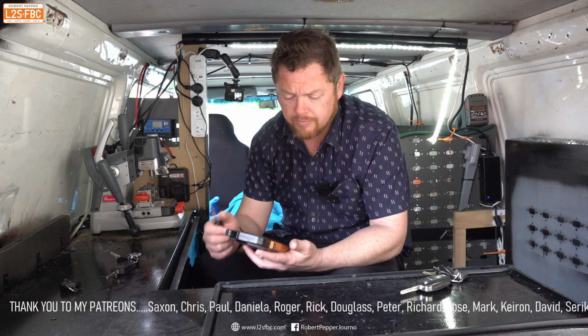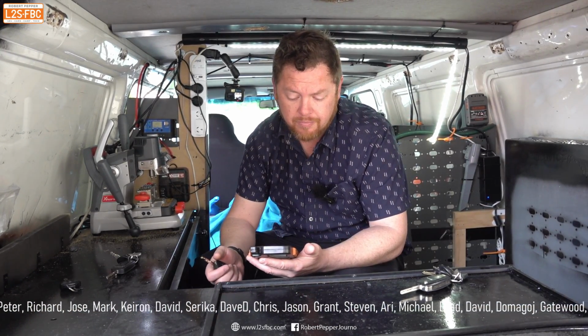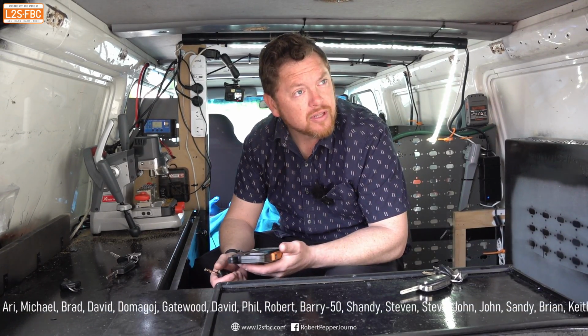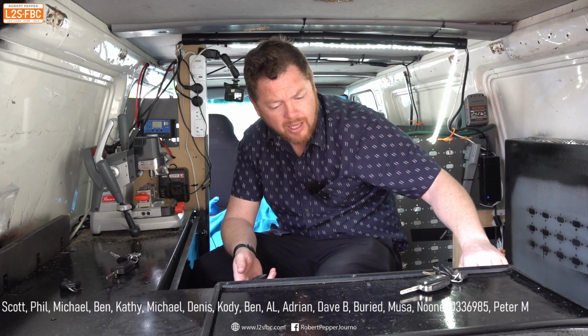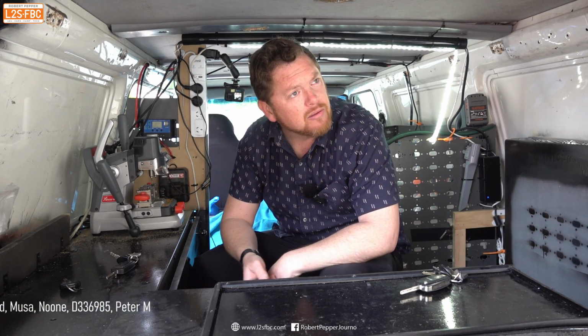So what sort of cars generally can't have their keys duplicated? A lot of Euro vehicles, especially Volkswagen after 2013. They use a system called MQB. They have to be entered diagnostically to the car's computer, and that requires wiping all the keys and adding them all back in again. So that's something only a dealer can do?